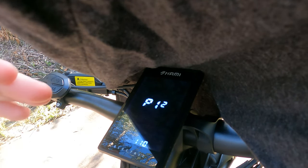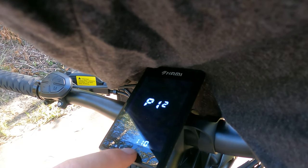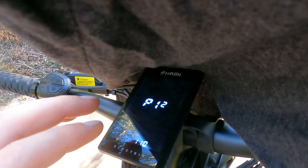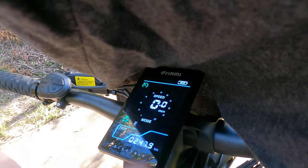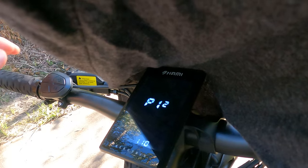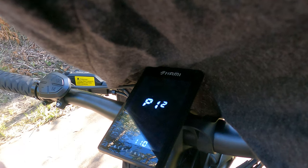P12 is your overheat setting. If the scooter gets too hot — the motors — this is the temperature at which it will automatically cut you down to 85%. It's set to 110 degrees. I'd probably leave this one alone, because that is what's set from NAMI. It's basically one of your protections against the scooter overheating. I'd really discourage anyone from changing that setting, as it will probably void something.